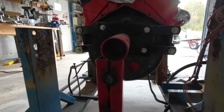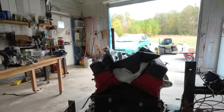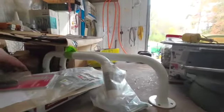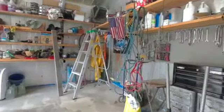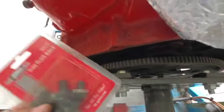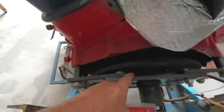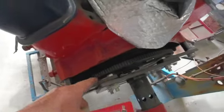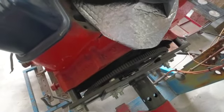I'm going to need the lift up here anyway so I can pick up the back end of this motor. I've got some flywheel bolts — or actually, these are flex plate bolts. These should be shorter than what I have in here, which I think are flywheel bolts, and there is a difference — the difference is how long they are. I think these are going to be the right ones. I've got flywheel bolts, but I've got them with a washer behind them so they won't hit the engine. If you put the wrong bolt in that little skinny flex plate, it'll hit the back of the engine. That looks right.